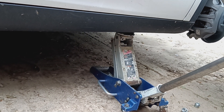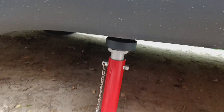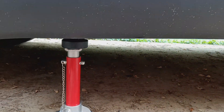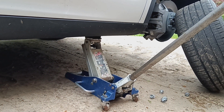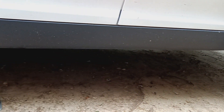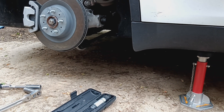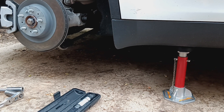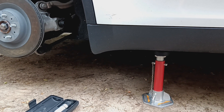You don't need three hands to juggle things — you just stick it up there, it stays put, and the bottom of the puck is applied right against the saddle on the service jack. I only lifted it from the front jack point, and you can use one jack point to lift the entire side of the vehicle. Back here I've used a second puck and just a simple jack stand on a very low setting. There was enough clearance at the back to get the tire off — it did clear, working from a single jack point.